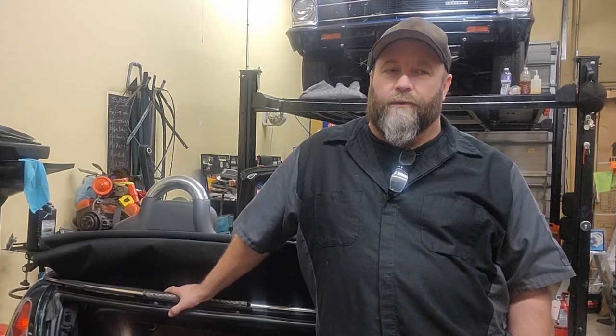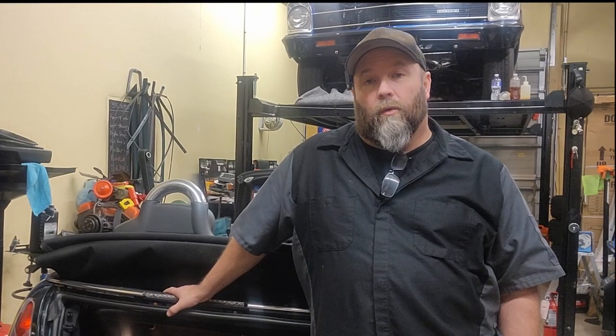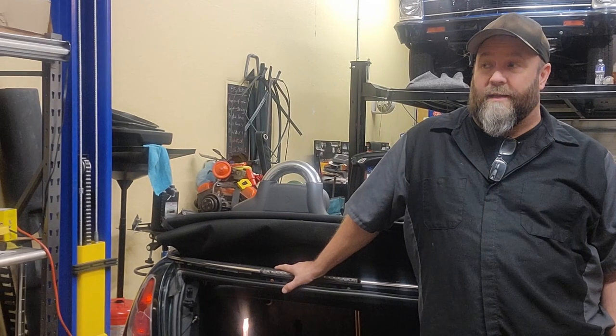When you go to put the roof down, it automatically rolls the windows down. The back windows roll down and sound really crunchy, which isn't a good thing, and they won't go back up. A little YouTube research — come to find out the regulators are cable driven through a window motor, and there is a holder that holds the cables in place that is known to break on these. You have to take the whole window and regulator out, replace or fix that part, which means the whole rear end of the interior has to come out. Seats got to come out, rear panels got to come out. Fun part is both sides are bad.